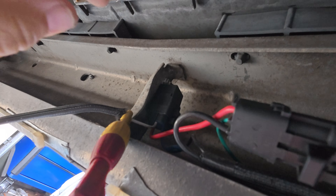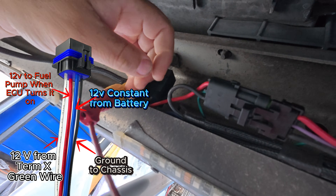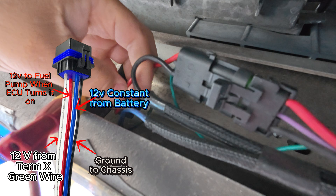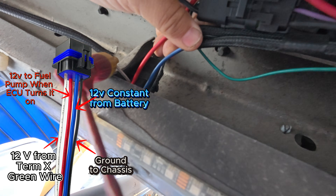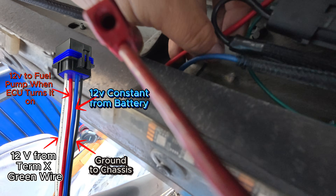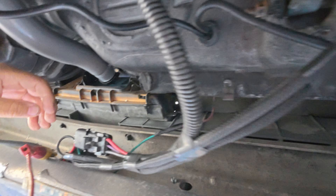Here's the relay right here. Out of the relay, we have a white wire — that's your positive, this is your control side. You also have the fat red one that gets power out. You have the blue one that should get power from the battery. This red one's going to go to the fuel pump. This blue one should come 12 volts from the battery through a 30-amp fuse. And then you have the black one here — that is grounded right there.